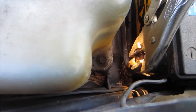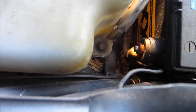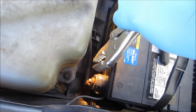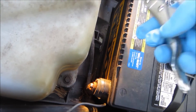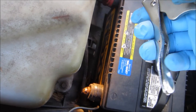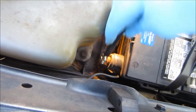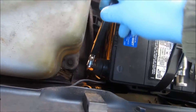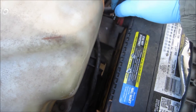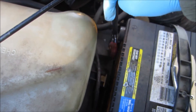What I'm going to do — and I'm not sure if it's a great idea — is snap a set of vise grips on there, break it loose. And there it is, came right off. That's the negative side. If this pair of vise grips were to touch anything metal it wouldn't be a big deal, but you'd have to be really careful on the positive side, because any wrench you put on there that touches metal is going to cause a big arc. By removing the negative side first, I won't have to worry about that — nothing will arc when I touch the positive because the battery will already be disconnected. And there's the positive side.